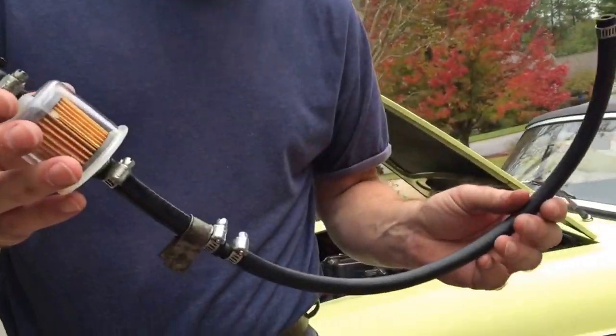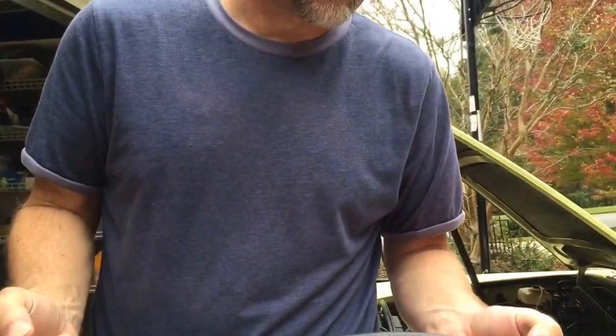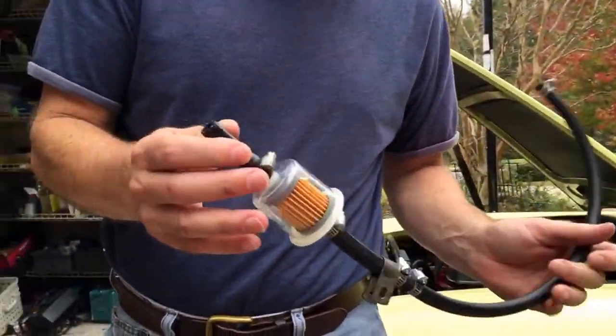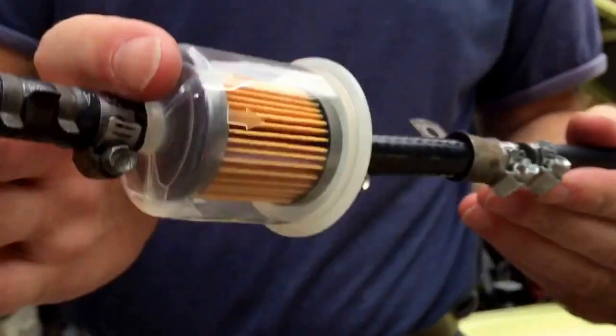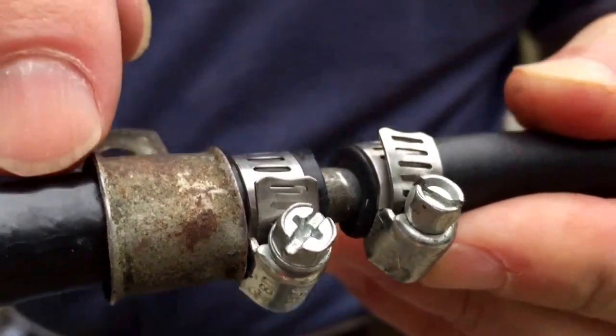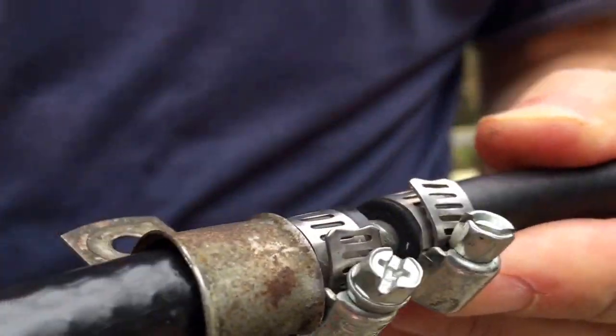Okay, what are we doing now, Dad? I've got everything on it — let's go back on the car. I used looks like a one quarter inch to go into the carburetor part, and these were five sixteenths. There's a little reducer here — I don't know if I got a good shot of that earlier, but there's a reducer that takes it from a larger size down to a smaller size for the carburetor.